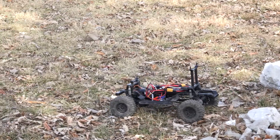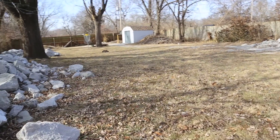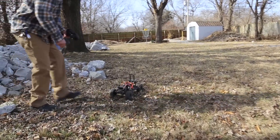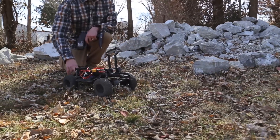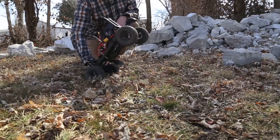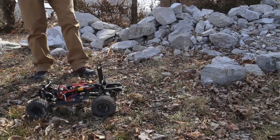We're going to put this in second gear — about the same wheel speed as anything else. She sings at high speed, and a lot of that is just my motor. Now let's show you this drag brake. I'm in second gear right now, so the drag brake is not going to be as strong, but it's certainly got a pretty powerful drag brake. I have it set at 30%, and combined with this Revolver motor, that's a lot of drag brake. Going to first gear — it's not even moving. We can lift the rig up by the drag brake. That's impressive. What that tells us is that the on-resistance of the ESC is very low, and the resistance of the motor is very low.